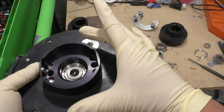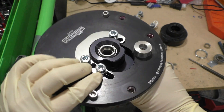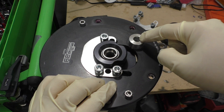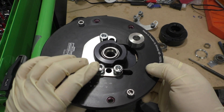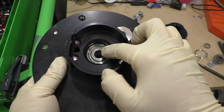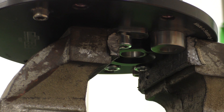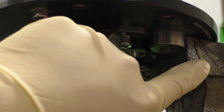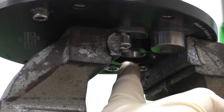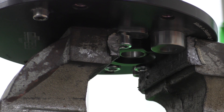The question becomes, if you have a bench vise and you're grabbing this circular part, how do you hold it? Make sure the metal C-clamp along with the bolts and your strut brace mount are in there, because then you can use the jaws of the vise to clamp against it such that this piece cannot rotate as you're hammering and spinning this little ring. Here you can see the underside of the plate mounted in the vise — the strut brace mount is up against one jaw, and the other jaw is against the screw and the main center housing around the monoball so the plate cannot rotate.